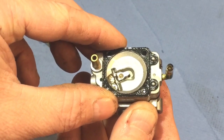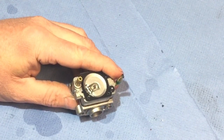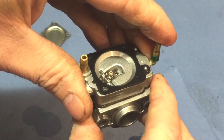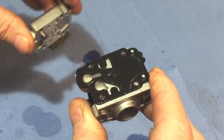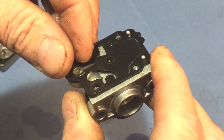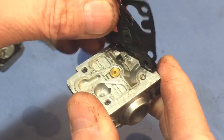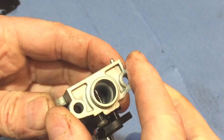Now we'll just separate it — there's a bit of muck on there. I've just peeled the gasket off, and that's what we have underneath — nice and simple. I'll see if I've got one of those diaphragms. If I have, I can get this carb cleaned up and back together quick, then try it on the engine and see if it starts. I have got the bit below. I'm sure I bought quite a few diaphragm kits for this type. It's quite loose — I think there'll be petrol in there. That all needs a good clean out. The gasket is underneath, and then we have the diaphragm on top.